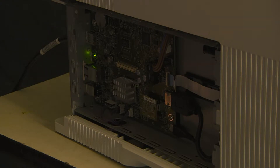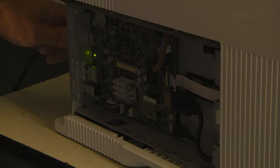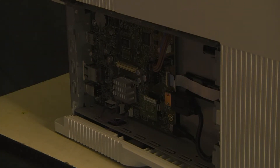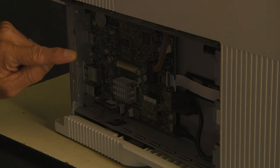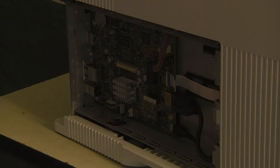So getting back to our topic — talking about power — I want you to notice something. I'm going to turn off the power. As the power goes off, you can see the heartbeat light is flashing a bit quicker. And I'm going to unplug the machine as well. As I unplug the machine, look — it just went dead. But if you keep your eye on that same spot, you're going to notice that every once in a while I get a little flash of light. There's another one. I've got that little flash of light taking place, but the machine is turned off and unplugged. Why is it still doing this?